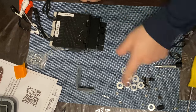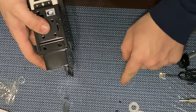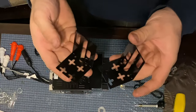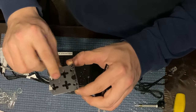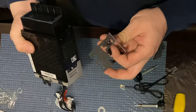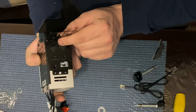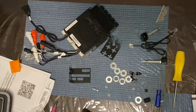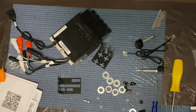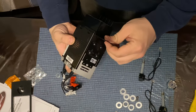I was sitting here counting all these screws thinking they cheated me, but there they are — tiny little screws. After you've got your faceplate installed, fourteen tiny screws go in these holes. When it comes to these brackets, they are directional. There is an R stamped in here and an L stamped in here for left and right. When you're installing — for instance this is the left side — it would go like this onto the radio. Line your four holes up. The good thing is you can adjust it front to back and up and down. Use these screws here to mount them on — you need a total of eight screws, and it'll leave you two left over.